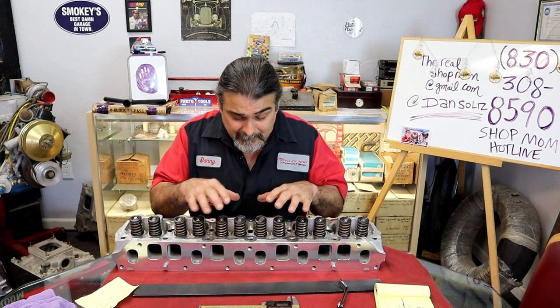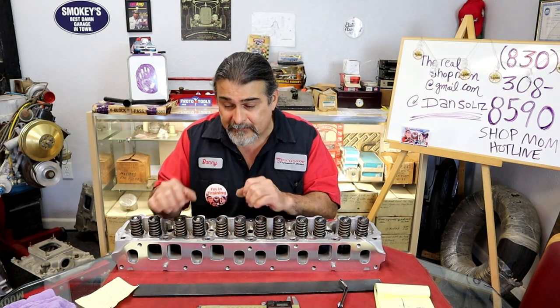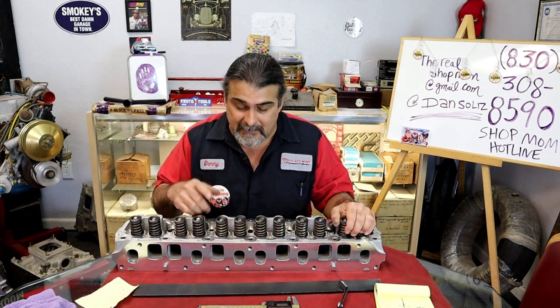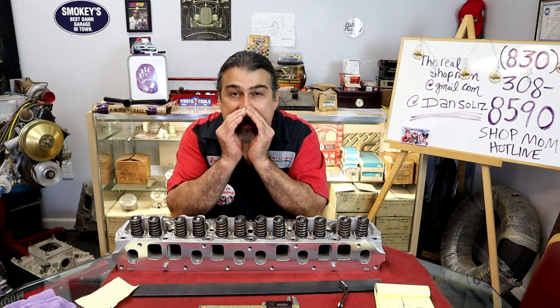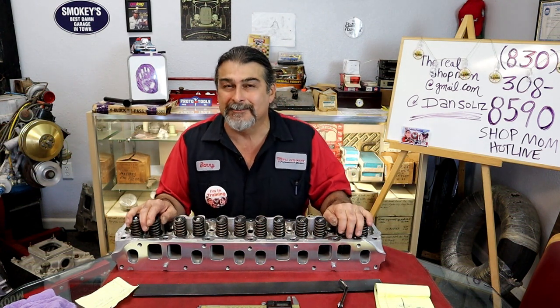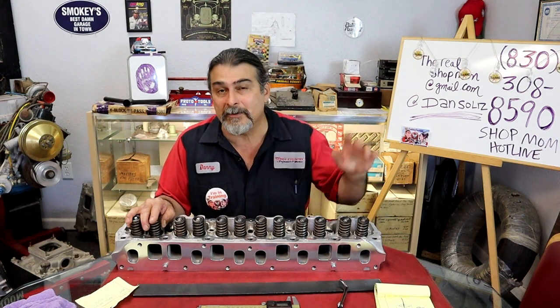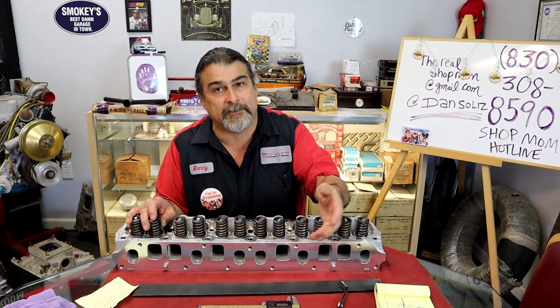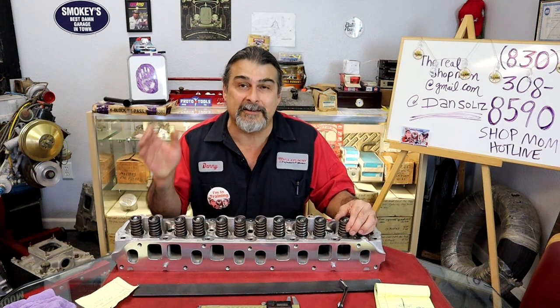But you need to know how it feels, because if you don't know how it feels, turning a torque wrench and waiting for a click, that bolt could be screaming at you, stop! And you don't know because you're listening for a click and nothing more. That's so bad. I tell people, go to a junkyard, go to a scrapyard, not a salvage yard that you care about the person, a scrapyard, take you a ratchet.